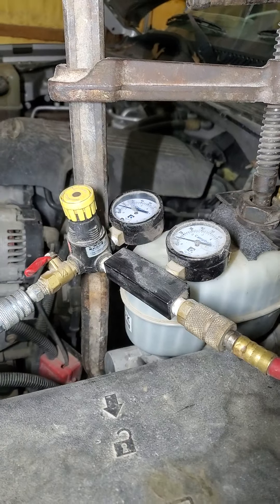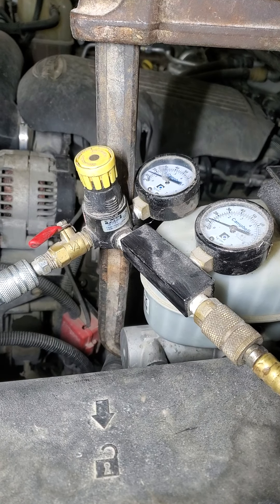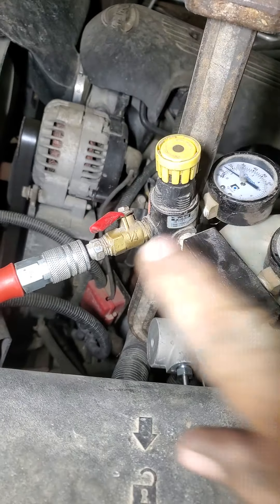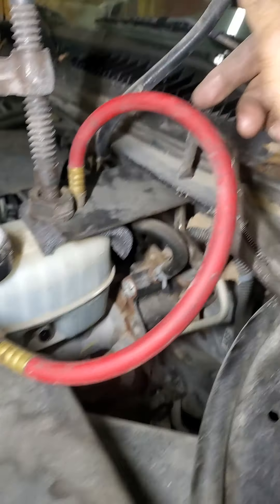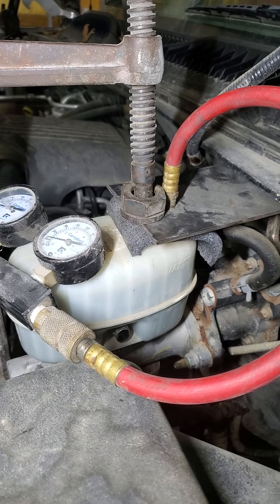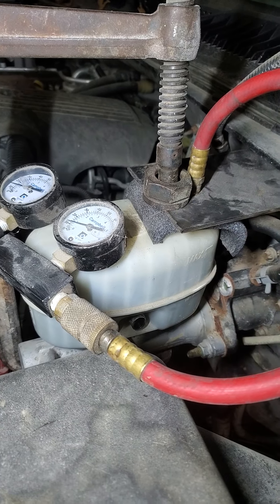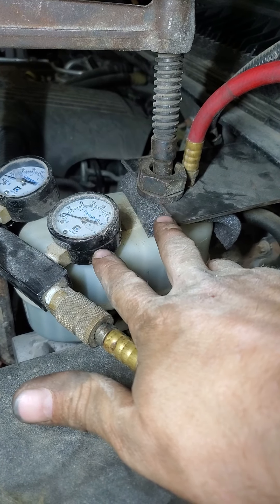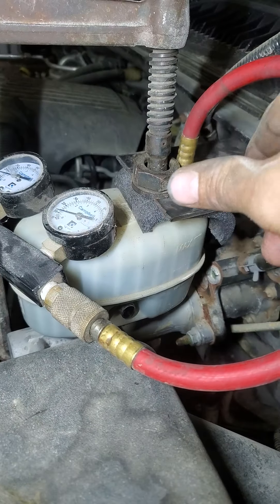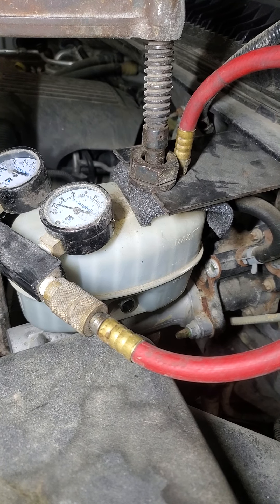Since then I've moved on to this wonderful, glorious contraption here, which uses my leak-down tester — I'm basically just scavenging it for the regulator. It's got a shut-off valve on it. I've got a plate that I can clamp to basically any master cylinder; it's just got a hole in it with pipe thread. This one I have clamped to the cowl to hold the back side, and I'm clamping the front side with one clamp. These kind of share a common reservoir, so it works for this.